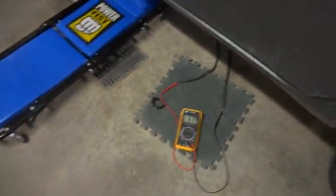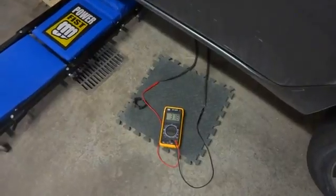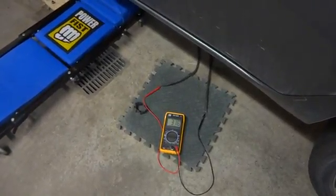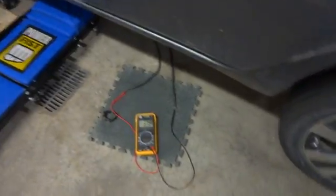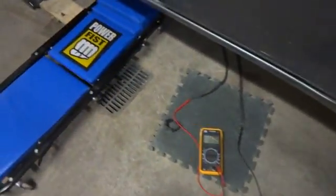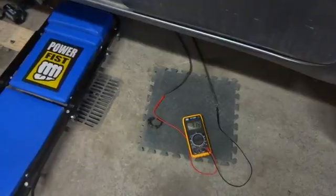I'll take my splice back off and finish plasti-dipping it. I've been doing this all day every half hour, getting it to be pretty thick. I want to be as safe as possible, so I'll continue plasti-dipping until I'm satisfied. Then I'll run those two wires to the back of the car underneath, and I'll show you how I'm using two fuses and relays to add my battery pack.